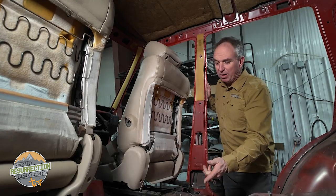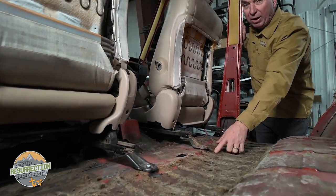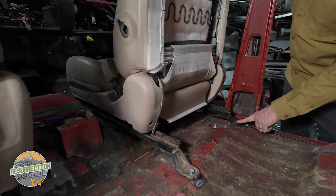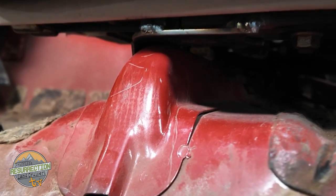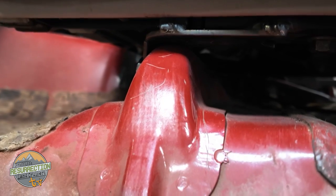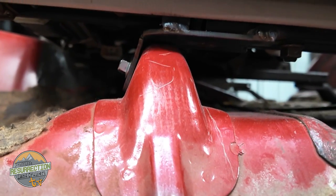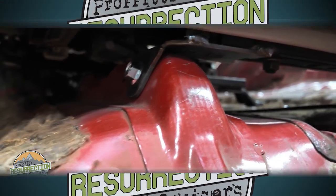Literally bad seat mounts. Anyway, so he's got a reinforcement plate welded under this body with a nut welded to it, and then the seat bolts to that plate through the floor just like the factory seats did. And then in the front, he's fabricated some different feet for the front of the seat sliders that bolt very close to where the factory seats did. These seats are mounted in a very OEM way, and they look like they should be there from the factory.